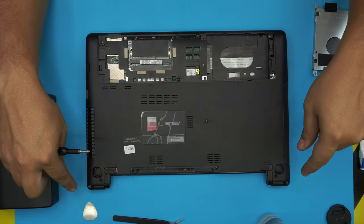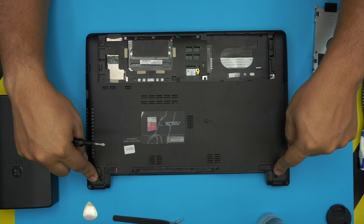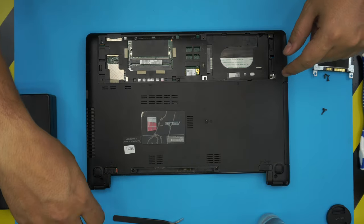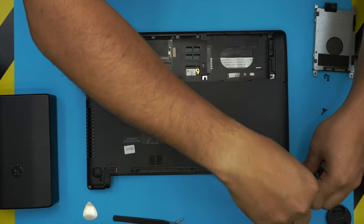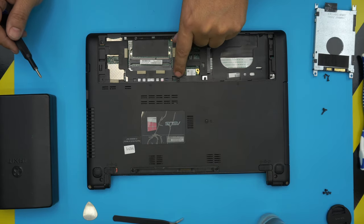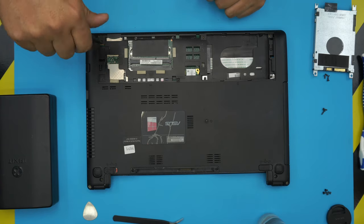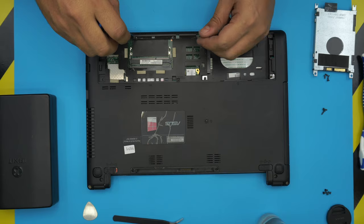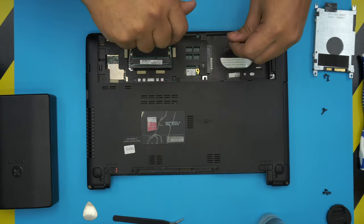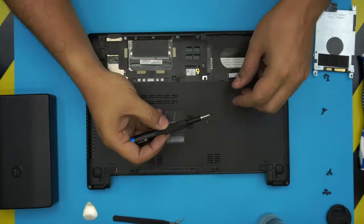Slide the hard drive towards the left side — once you see the pins disconnected, go ahead and lift it up and put the hard drive to one side. Now we're going to start removing all the screws on the bottom. Keep in mind the two screws on each side by the hinges are the short ones — I call them the hinge screws. Remove the four hinge screws first and keep them in one pile, then remove all the screws under the battery area. Note that sometimes one screw near the DVD drive is a little longer than the rest.